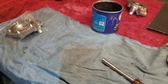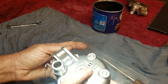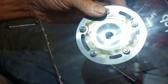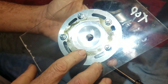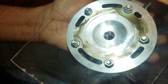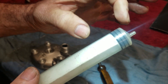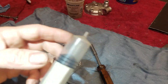Thin layer of grease around it so it seals. I'm going to bring the water all up to the edge to get a measurement. I understand that's not the most accurate way to get the actual CCs — the accurate way is to measure from the bottom with the spark plug in the spark plug hole. But I'm just looking to copy the same CCs, so this will do as a reference to copy the OEM CCs after I've milled the head to get the squish band right. I put a mark here so later I can use this syringe to bring it back to that mark and measure the exact CCs.